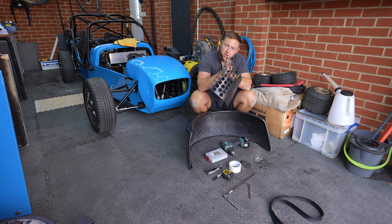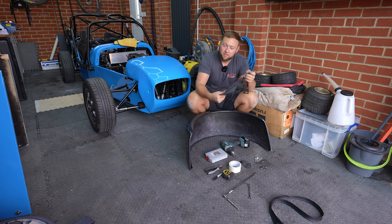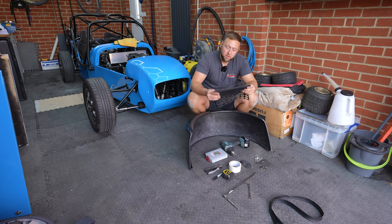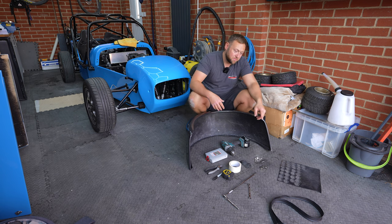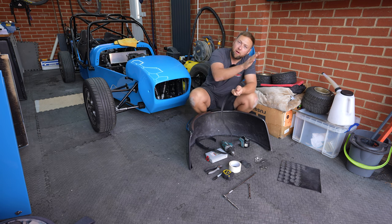And then we've got these little rubber washers that I made. Cheeky little sheet off Amazon, £5.50, 2mm rubber. Just so you put rubber washers either side of the body and the arch, just to take - if you do get any flex or someone sitting on your arch while you're away - it'll just take that little bit of load out. If you're going to do them up tight, you could quite easily put a crack in either the carbon or the body. This was like five quid. I've cut enough out of there - we just used a hole punch, hammered them out, so we've got them.